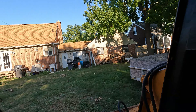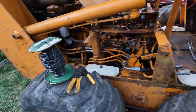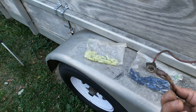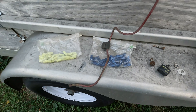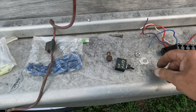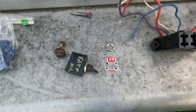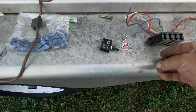Let me see if I can find some wire so we can continue on this. I went and scrounged up some wire — just black and white but they'll work for what I need. I scrounged up this piece of wire that I think was already on the machine — it's got a 30-amp fuse in it, so we're going to fuse this guy here. This is a fuse block, so we'll fuse this with the 30 amp. Can't imagine those lights using more than that. I got this switch that I found, and a plate — it kind of says on and off, so up would be on. It's going to work.